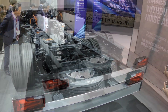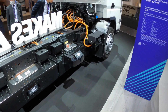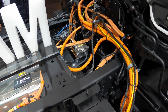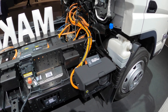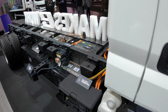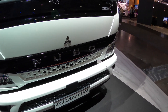The e-motor is mounted up near the front and there's an e-axle at the rear as well. You can see the e-motor in here — it means there's more space because it has an integrated differential and no propshaft. The old E-Canter had two-stage regenerative braking; this new one has four-stage regen.